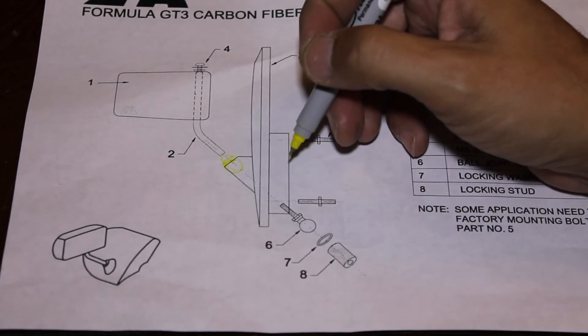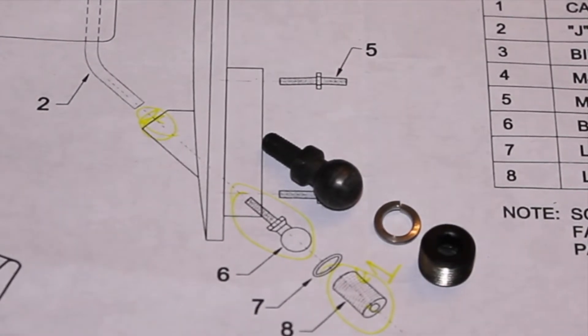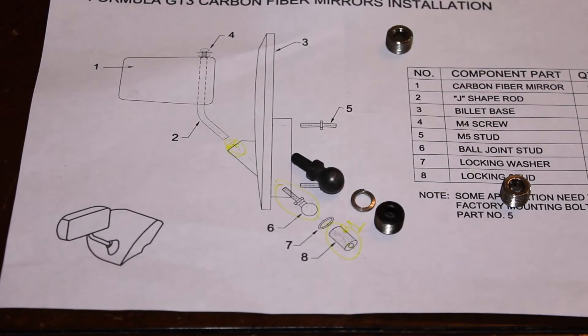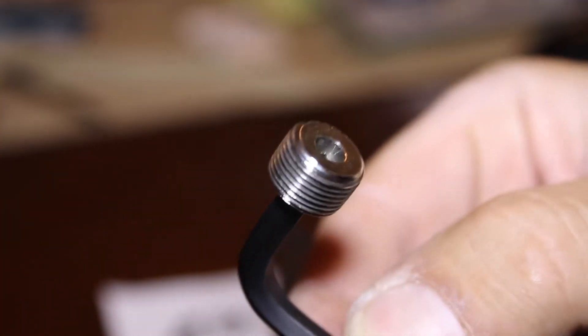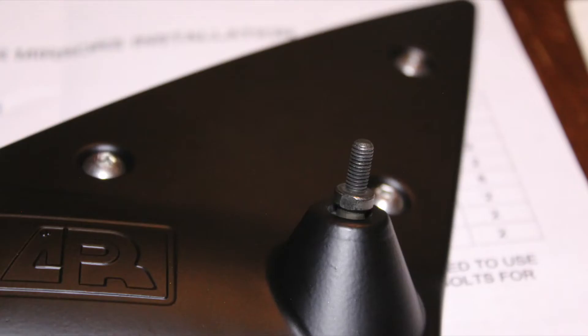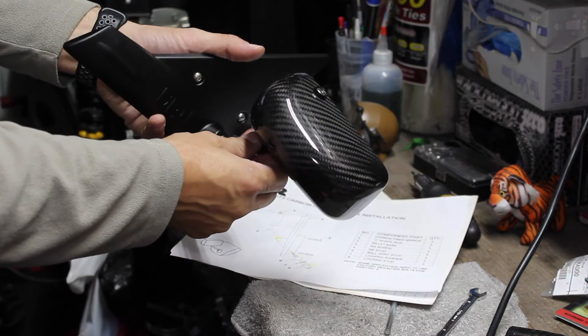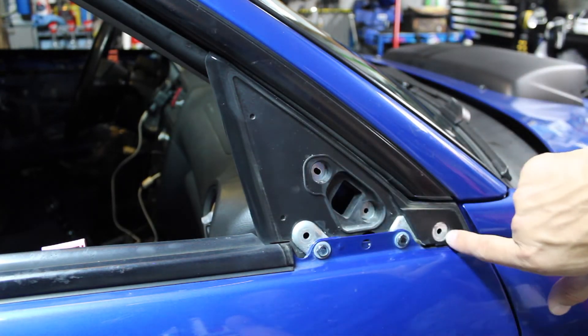The first part of the installation is to remove the stock jam nut that came pre-installed from the factory on the back of your bracket. Use the five millimeter hex key that they provided. Then insert the ball stud through the bracket so that the threaded section sticks out, drop the washer in, and tighten the locking stud all the way down. Then use one of the shiny locking studs with the five millimeter hex and tighten as much as possible — that creates tension on the ball stud and aids adjustability when you move the J-arm. Attach the carbon fiber mirror to the J-rod, reinstall the screw, and use an eight millimeter open end wrench to attach the J-arm to the ball stud. Experiment with different combinations of the stock hardware and the hardware supplied in the APR kit.